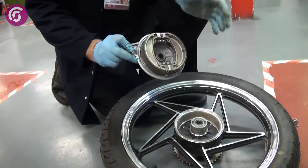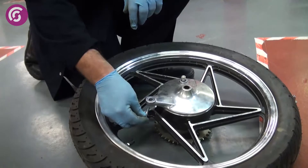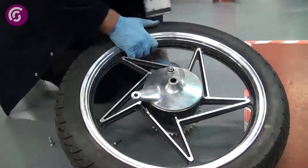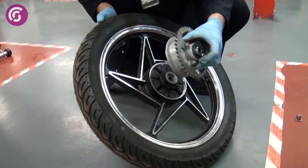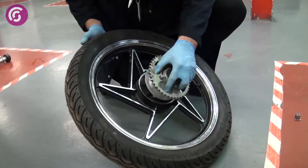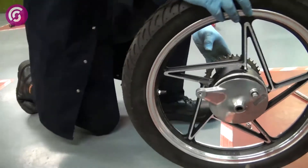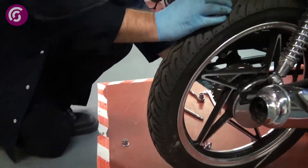Once you've measured both sides, just pop it back into its recess. There's your torque bolt — that just flops about in there, so we just need to put that in last. Make sure that the spacer is still attached in there. Whilst it's off, make sure there's no damage to the cush drive rubbers — if there is any damage they would be rocking about in there. Then we need to slide it back in as far forward as possible.